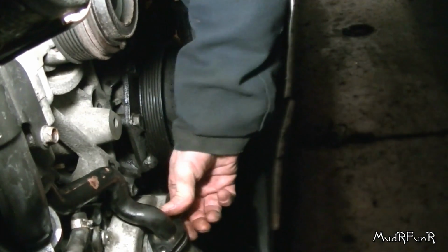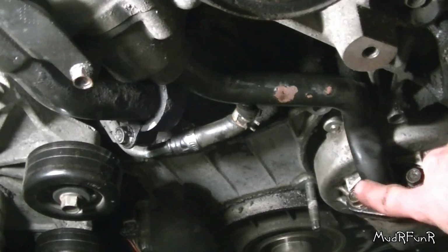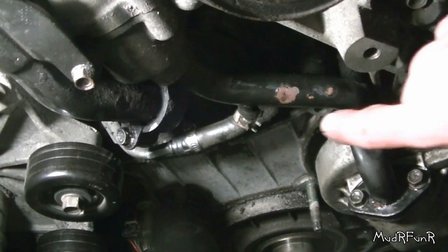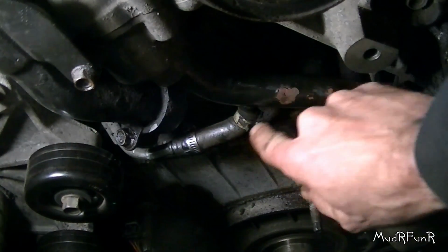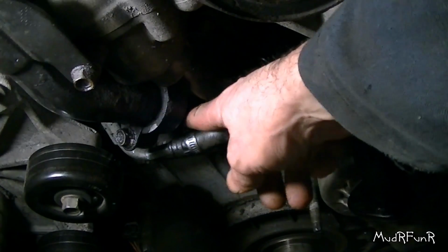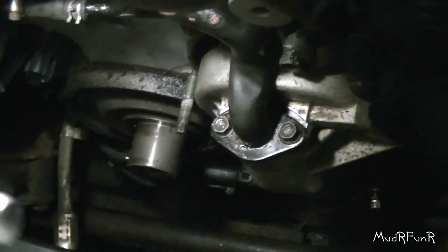And the 2 bolts back in. Put this hose on and we should be all set. I've got these 2 bolts torqued down to 216 inch-pounds, and now I'm going to slide this hose back on. See how that worked out? Slid it all the way up to here, and now all I got to do is slide it back onto that one and tighten up that clamp, and should be all set. I just used my channel lock pliers to slide this over. I've got my clamps in place and nice and tight. And while I was down there before, I put the lower rad hose on. Just have to tighten it and do that from here.